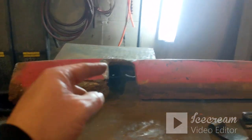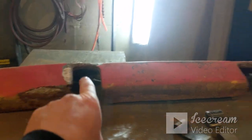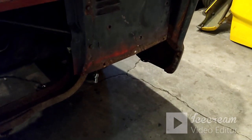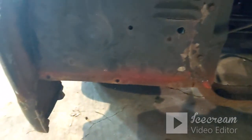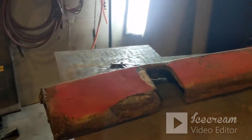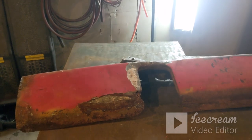And then the headlight support bucket supports that goes behind the grill, it bolts to that, like the core support. That's what it bolts to. When I got the truck, it was only bolted to the fenders, but down there across the bottom lip, it bolts there, and then to each fender. So I'm gonna see what I can get to line up.